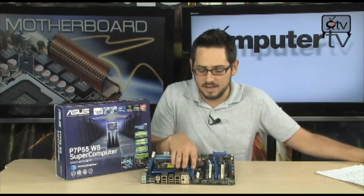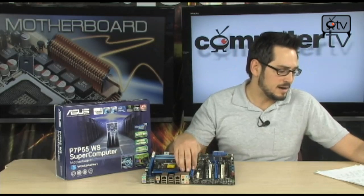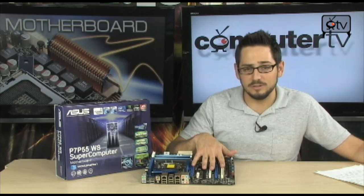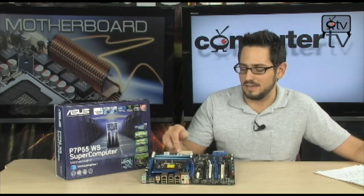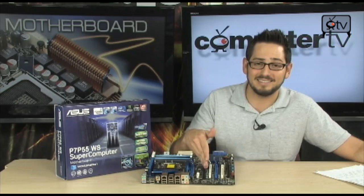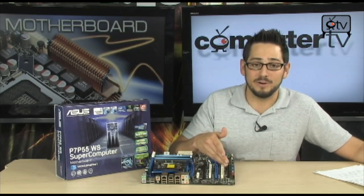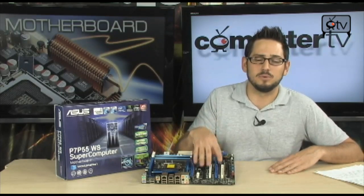Take a look at this first lane right here. If you put one card in there, it's going to be X16. Now if you put all four — normally that's 32 lanes of PCI Express — but this can only do 16. The NF200 chip turns that into 32. So if you populate four Teslas in here, they're going to operate at X8, X8, X8, and X8. That's very, very impressive. You might be thinking: great, it's PCI Express 2.0, just as fast as old X16 PCI Express — so they can do four-way SLI on this board.